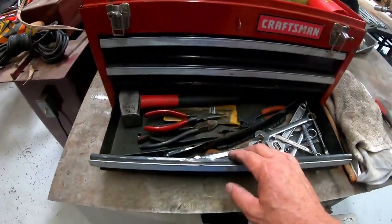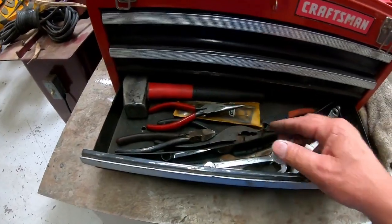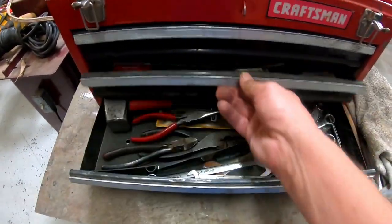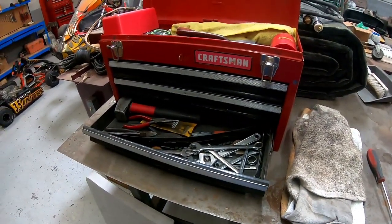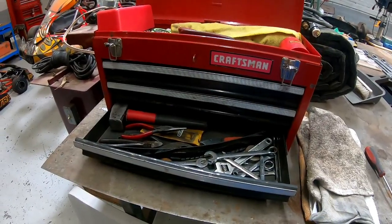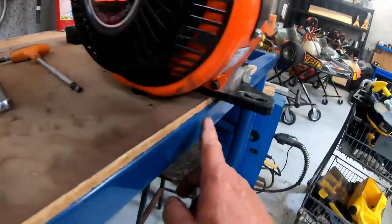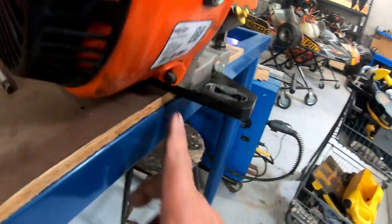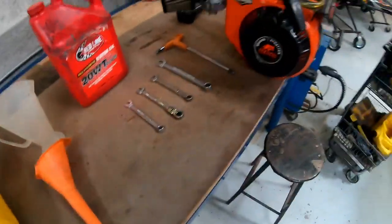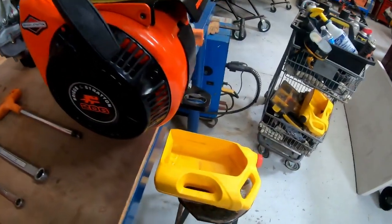Sometimes you'll need extra tools beyond what I put on my tray — needle nose pliers, cutters, different size torx or allen heads. I'll do a different video later to show some of the things I use for road racing as well as local club racing. Now, I've got the motor out of the cart and sitting on my workbench. What I do is hang it so where the oil comes out of this plug right here is hanging over the edge maybe half an inch, then I put a stool underneath it with my catch pan below so all the oil will drip into the pan.